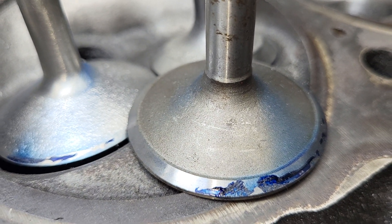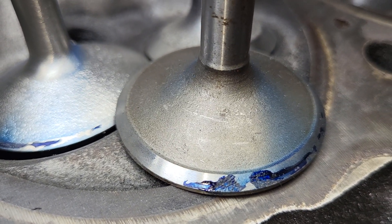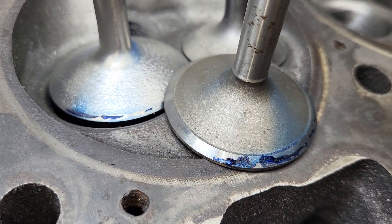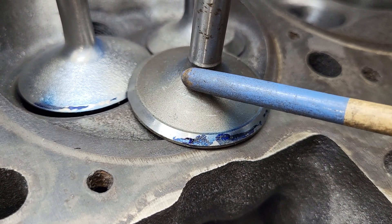If you look at my brand new 318 valves, you can see the shaft is machined, so I would have to run the burr around that radius. In reality, if you want to do that and make it strong, this would need to be polished in here.